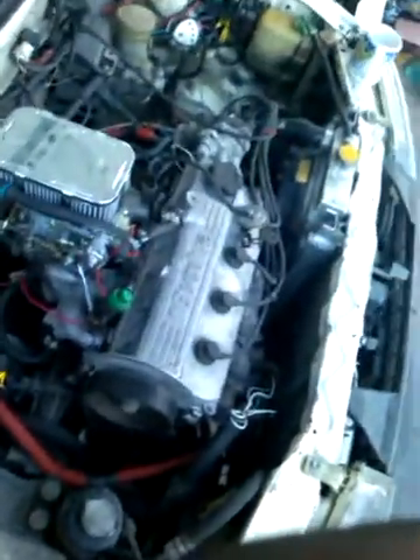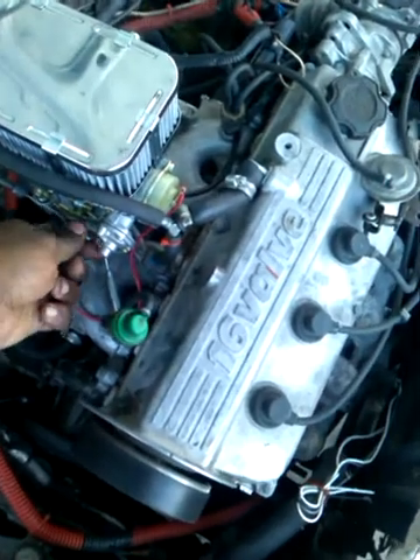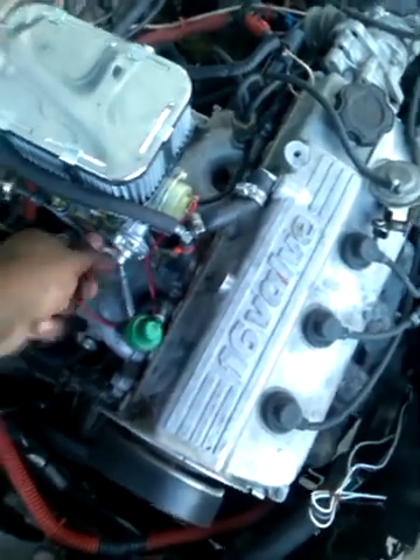Also, you have to change the fuel filter, because you may encounter a flat spot when you try to do a hard acceleration, something like that. But if you wait like 1-2 seconds, it runs pretty well.